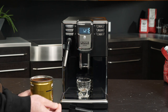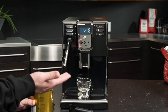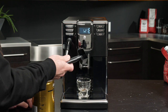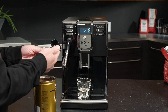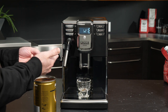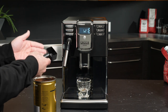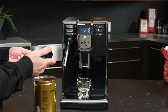You always want to make sure the pre-ground coffee you're using is calibrated for espresso. Something that says 'espresso grind' will let you know the coffee will be fine enough to produce an authentic espresso with crema. If you use something ground more coarse you'll simply get brown water out of your machine. The next important step is to make sure you're using the calibrated scoop — not only for adjusting the grinder but also for guaranteeing you use the appropriate amount of coffee in the bypass doser. You never want to use more than one level scoop when brewing with the bypass doser, as overfilling can overload the group and dump your shot. Also, level the scoop but do not compact it, which can also cause issues with brewing.